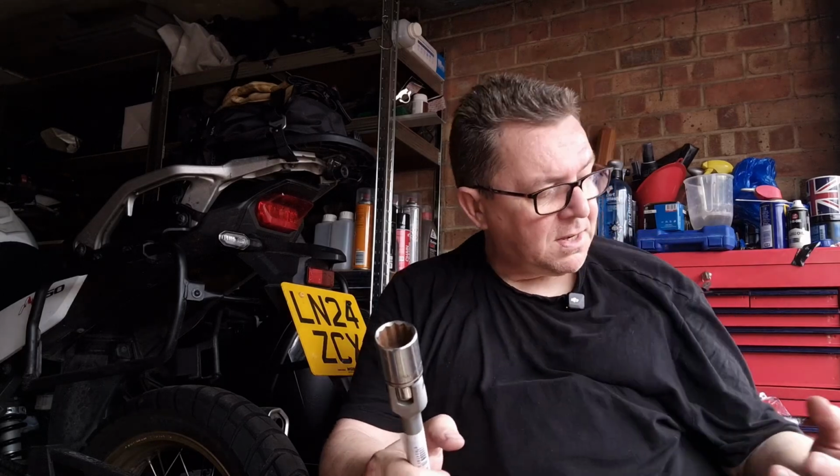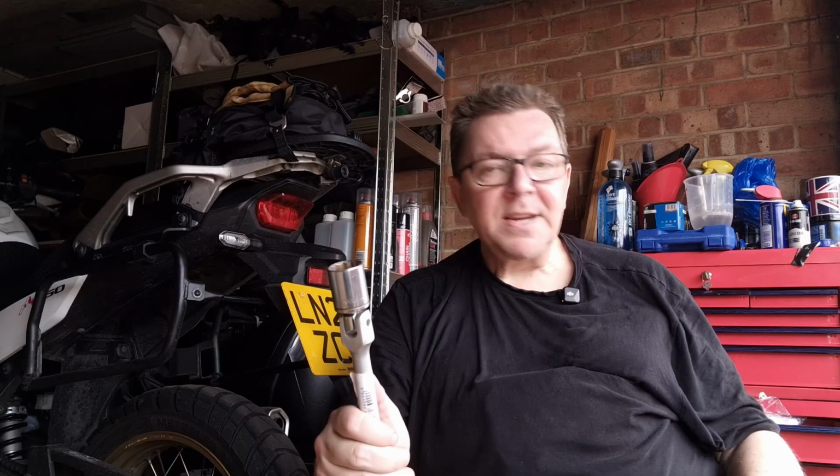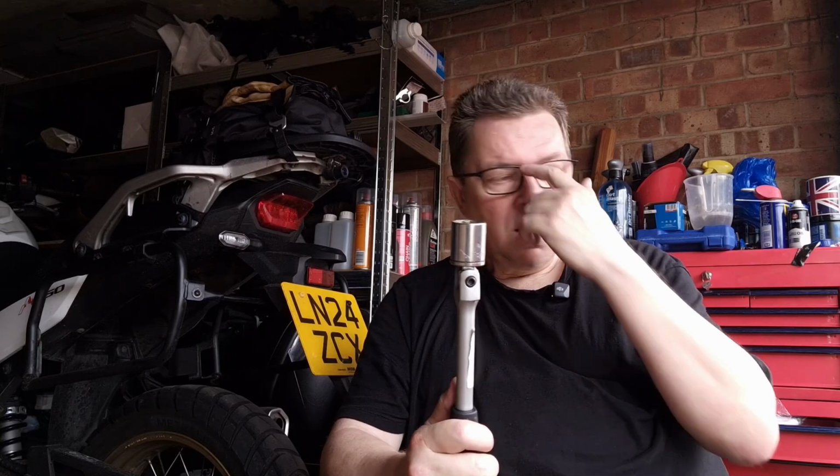But it came off. And we replaced the O-ring. Replaced the filter, filled it up with oil. It started. There doesn't seem to be any leaks, but I'm going to hunt down the proper tools to get that size filter off. And I'm going to get a 25mm, 1/2 inch socket for that job.